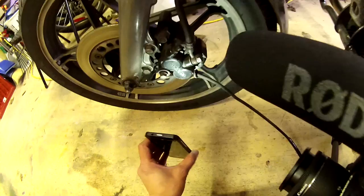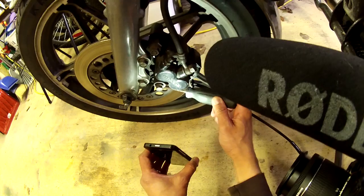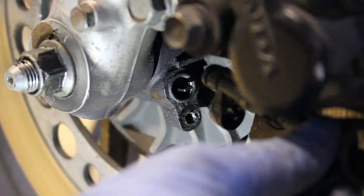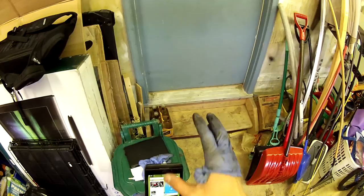At the wheel end of the speedometer cable is a screw, I'm just going to unscrew that. So just pull it out this way.